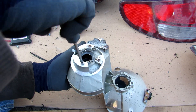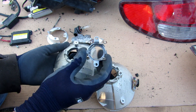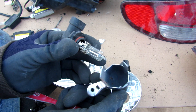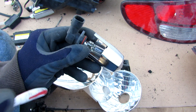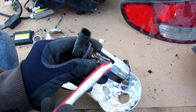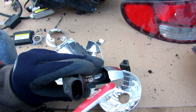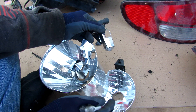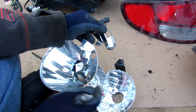I'm just going to unscrew these shields so we can have a closer look at the bulb cap. Here we can see the holder for the bulb that secures it into place. The inside of this bulb cap fits inside of the bulb — you can see the bulb is going to sit here where its focal point is going to be outside in this little space over here, and that's going to allow light to escape out both sides. The top and the bottom isn't nearly as important — you can tell from the shape of the parabola that it wants light to escape more out the sides as opposed to just up and down.